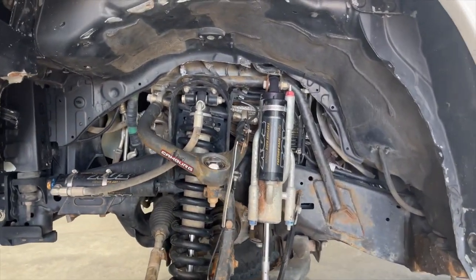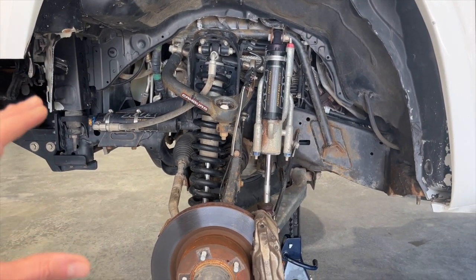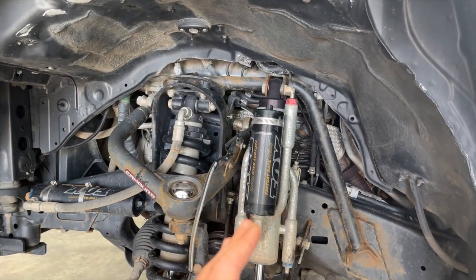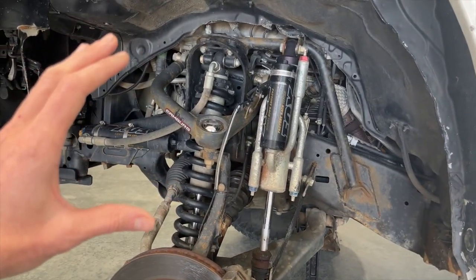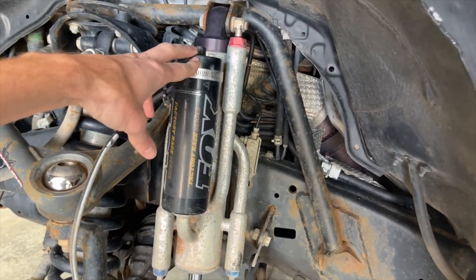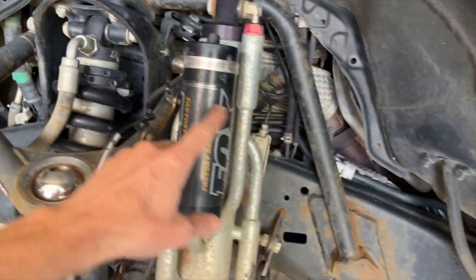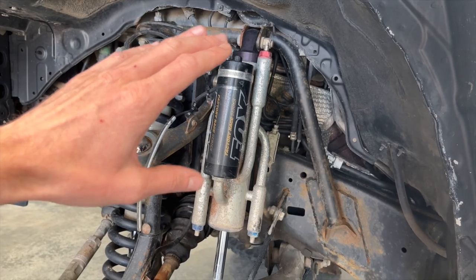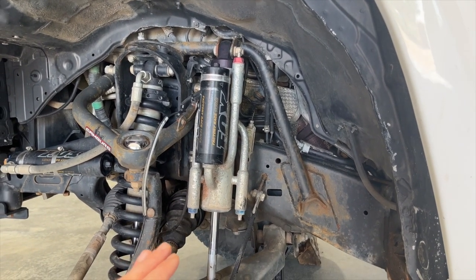Let's jump into the components so you can understand what you have to put in here to get this level of travel and control. Right off the bat, you're going to notice there's not just one shock here — a coilover like the factory truck — there's two shocks. The second shock is what gets you all of that control. The longer stroke and the way the lower arms and upper arms are set up is what gives you the additional travel. But this is the brains of the outfit — a triple bypass piggyback shock. When it's called a piggyback, it's because the external reservoir is straight on the shock body rather than on a hose. You can control your compression and rebound on this, which keeps your system from bottoming out without having to rely on your bump stops.